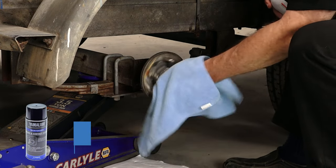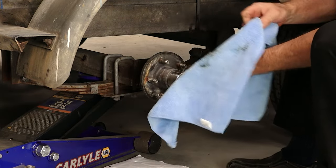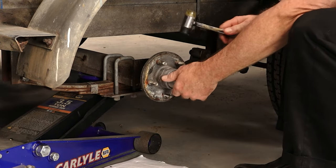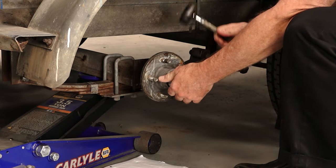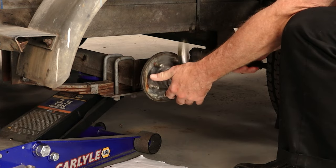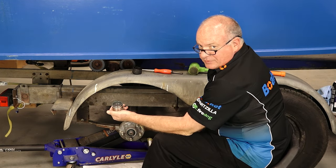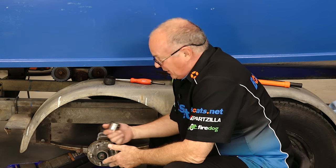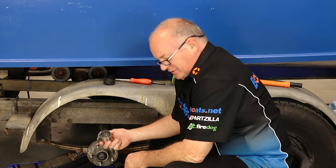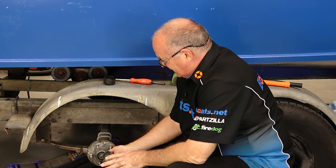As you're pulling this apart, it's better to take off any dirt on the outside now — that way you don't have to try to extract it from the grease and the bearing later. I'm using a soft blow hammer and just hitting it at an angle; that's the best way to get one of these out. Once you get to that edge, you can use either a pry bar or a screwdriver, or if you're patient enough, it's going to just knock off. This one's in really good shape — I know because this is my trailer and we go through this process every year. If yours has been abused, it's going to be jet black or worse, completely empty. But this one has the appropriate amount of grease in it. It's not completely worn out, but we're still going to repack it anyway because this is about preventative maintenance.